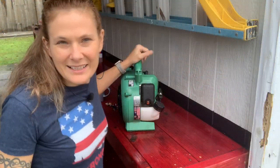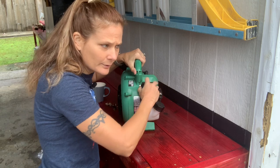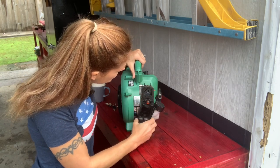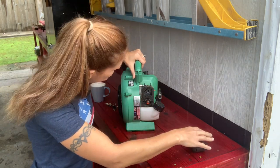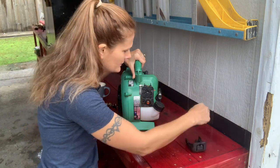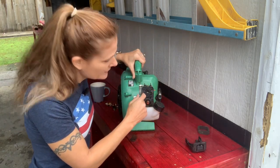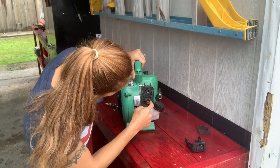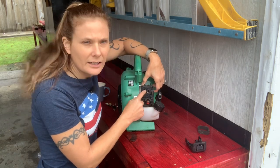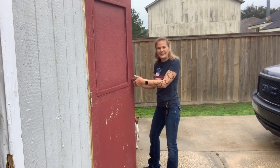The first thing you do is remove this little intake cover — it's just got a little slot, you push it down and pull the top. Different ones are different but they're usually about the same. Set that aside and don't lose it. This is the little air filter — you could pull that out and clean it up. This right here goes directly into the carburetor, so what we're going to do is remove this little plastic spacer here, and it looks like it takes a Phillips head screwdriver.